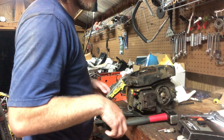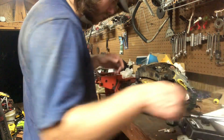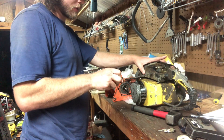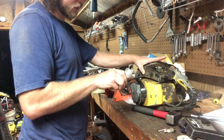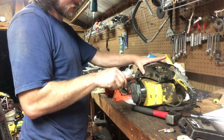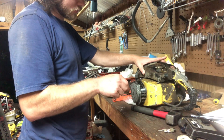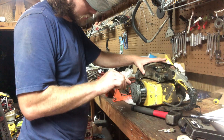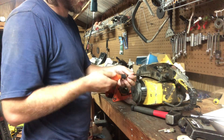Let's see if we can pull the carb off. It's going to have to come off anyway. Looking for a small screwdriver — we get to see how far these needles were out. The top end was only out half a turn. The bottom or low is out half. They're right at half, or this ain't being real sticky — so that's not that good. Let's pull these out so we can get down in here and really take a look.